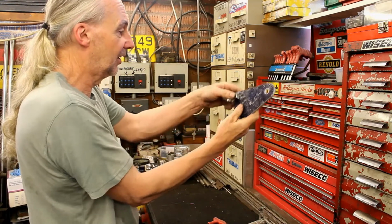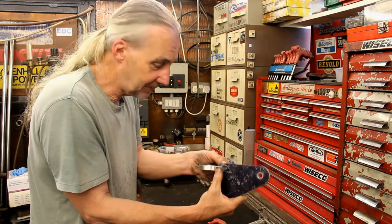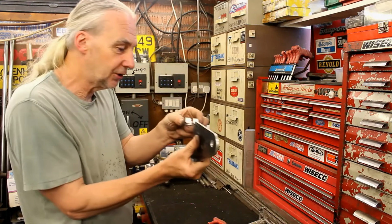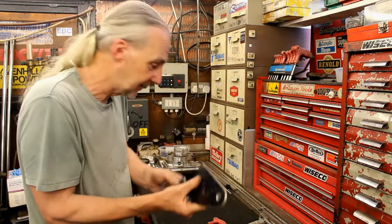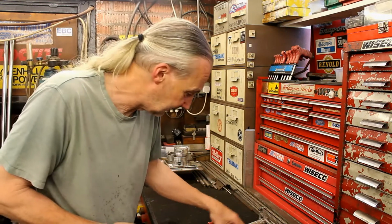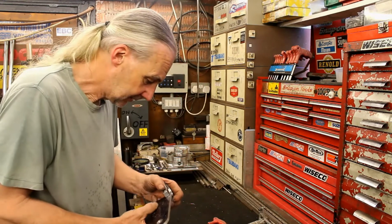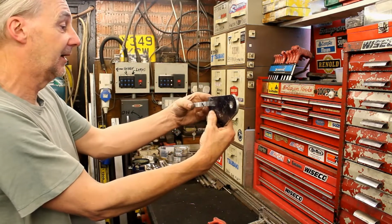They want sliding on. Now what you might find is when you tighten them, it could be a fraction loose, which means we may just have to draw file. Just enough so that it grips the fork leg perfectly. It's just a little bit of give. Jiggery pokery, that's right. So, you know. Right, and also, you could just try them like that for now. You could just place the plate there and nip them on.